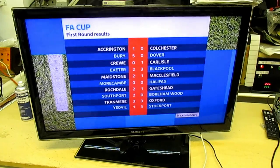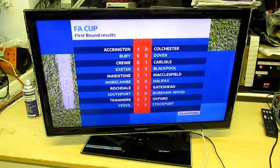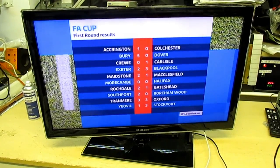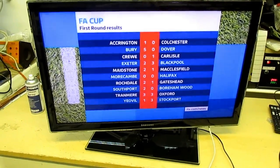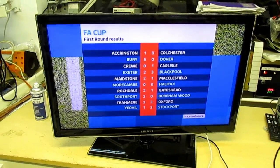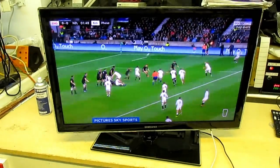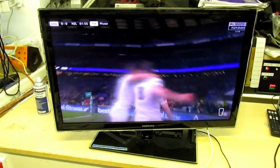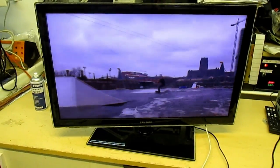So now, if you remember before, it was something like 5 seconds before it went off. So if we switch it on now, if we count 1, 2, 3, 4, 5, 6, 7, 8, 9, 10, 11, 12, 13, 14, 15, you can see I've counted well over 5 seconds now and the TV's staying on. Now while that chip's super cold, this TV will now stay on long enough for you to update the NAND chip with a USB memory stick. Before, we had only a 5 second window. This will stay on now for a considerable long time. It'll be well long enough to reprogram that chip now without putting a new one in. So let's just watch the weather a minute then.